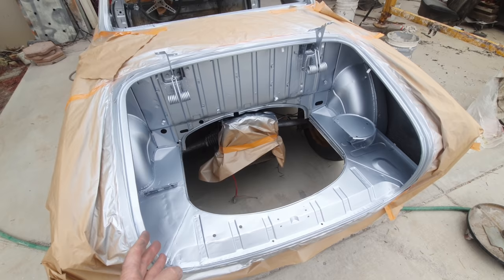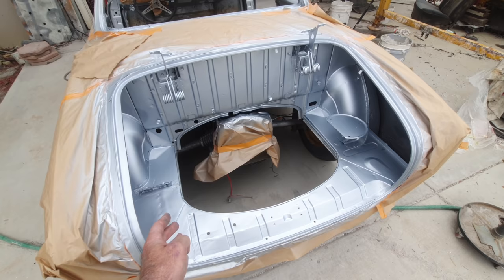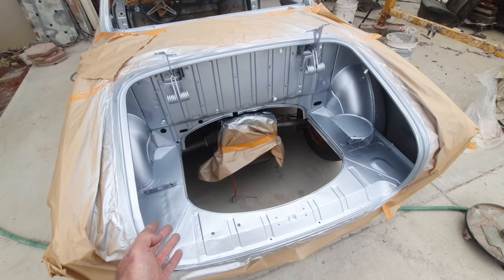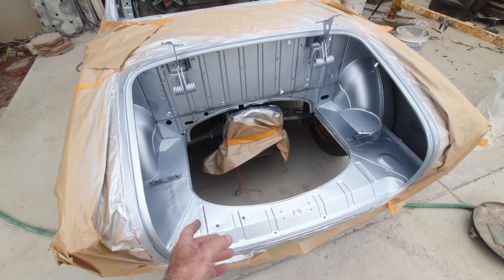I'm not trying to get this part at all. We're just not even trying. I just go through and sand it just enough to get it to adhere, and then I put the DTM sealer from Tamco's primer. It is also good as a DTM sealer, and it has really good adhesion, better adhesion than paint. So if I put a coat of that down first, and then I go over that, that's going to help it adhere to some parts where I probably didn't get sanded.